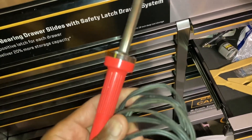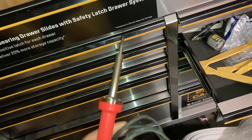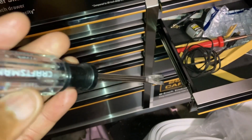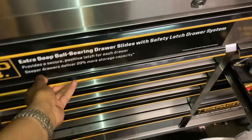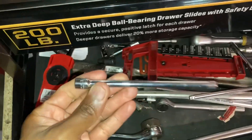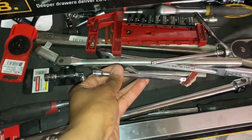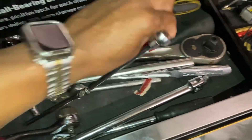So first step - it's kind of mixed up and jumbled up, but just pay attention to the video. You're going to need a soldering gun because that flimsy plastic bumper might break or chip where it screws in. You're going to need an upholstery pry tool to pry the push pins off. You're going to need a 10 millimeter deep socket and this long quarter inch extension. If you got two of them, you might want to pull them out. You're going to need a little quarter inch baby ratchet.